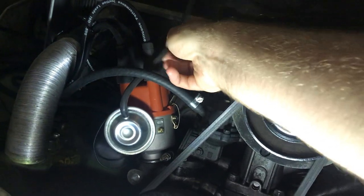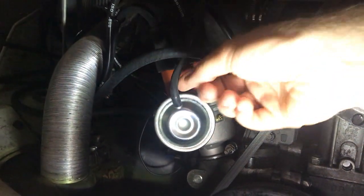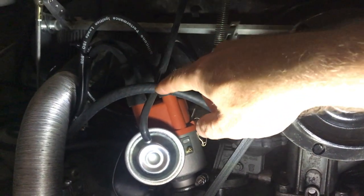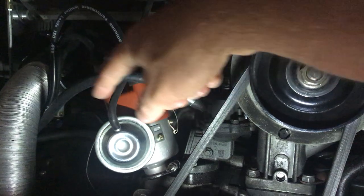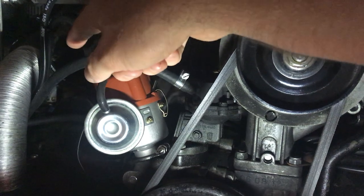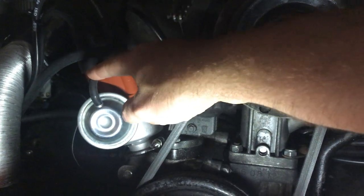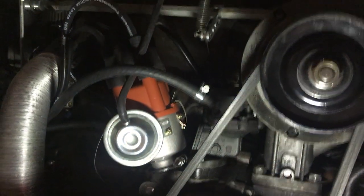The vacuum hose is hooked up this way. If you're going to hook up a vacuum hose for dual carbs, one thing I've learned over the years is to have it going up in the air. The original design had what they call a shepherd's hook into the single carb. It's important that this goes up and then back down to the carbs, because there's a chance fuel can come out there, and if it has a direct line of travel you can end up with fuel in your distributor, which is a very bad idea.